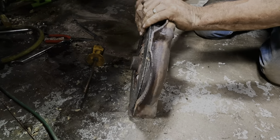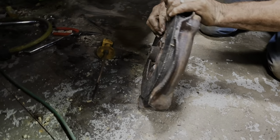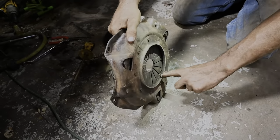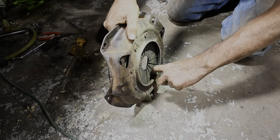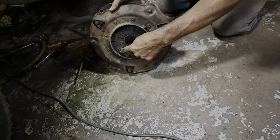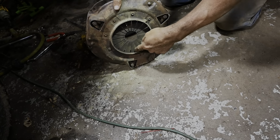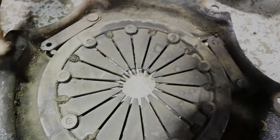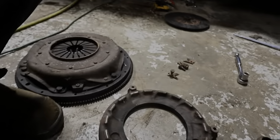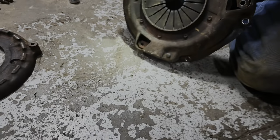Okay. See that? The clutch ain't sticking past these faces here. It wore out. Well, I don't think so. I think what's going on is, see right down in here? I think all that crap is holding it, not letting these come. See, these fingers should be up against this metal piece, and they should be angled up this way. If I could have blown that out more, it probably would have worked, wouldn't it? It's all jammed in. Yeah, you can tell just from this one how it's convex, and that was just flat.